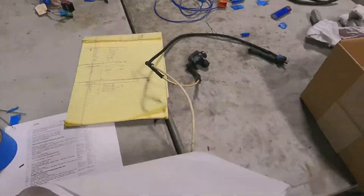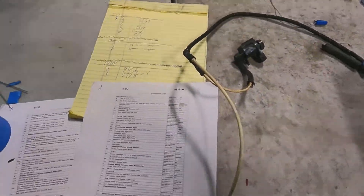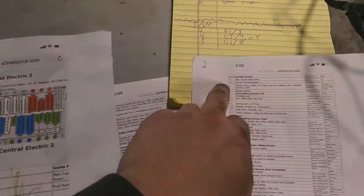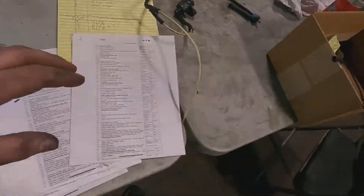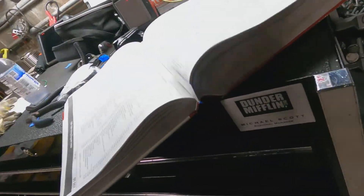The best thing you can do is use the A2 resource — they give you everything for CE1 and CE2. Obviously since it's a Mark 3 this is a CE2 car, so it's a decent amount easier. You can just go through — if it says A1 right here, you go over to the fuse box and you can see A1 plug, it tells you exactly the position, like A1-O1, left headlight, and the exact color it is. This is a really good source, but still there are some that are a little iffy in there. Don't just go off some forum post — always have Bentley manuals for these older cars, and make sure you're looking up your exact year.